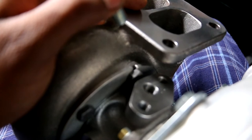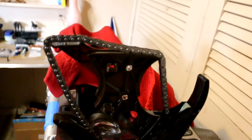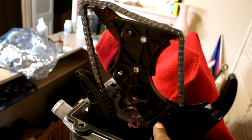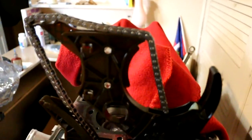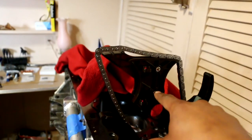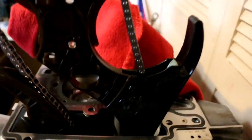In the meantime, I put on the upper portion of the timing chain. The chain rides on one guide rail on the right side, and you clip this piece into the lower half — it's just a snap and clip. The chain runs along the other side, and once you drop the head down you've got two areas where it bolts to the head. The upper timing guide is now locked in.